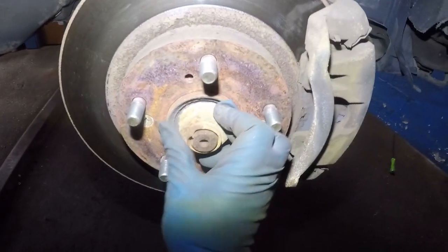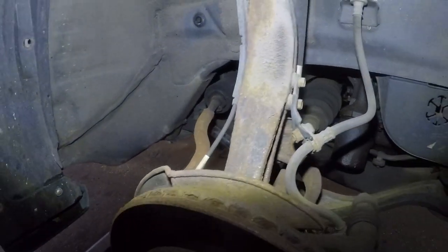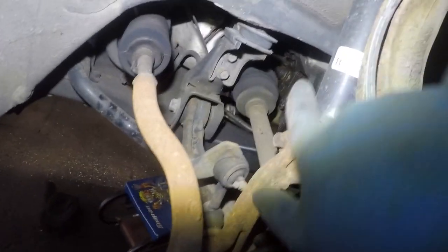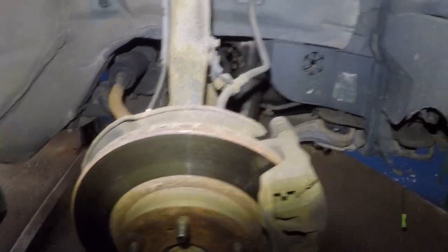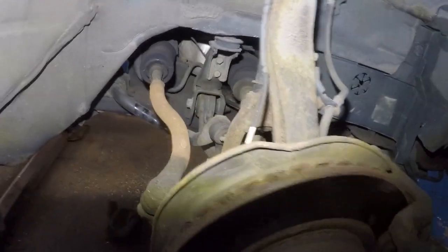And this might be a 36 or a 32. And after that, well, I'm gonna call the customer up, breaks it down to minimum. All right, but anyways, this comes off and we'll pull off the axle and then we'll have access down there and we'll remove the intermediate shaft. You are gonna have a little bit of transmission fluid come out. So we do need to top it later on.